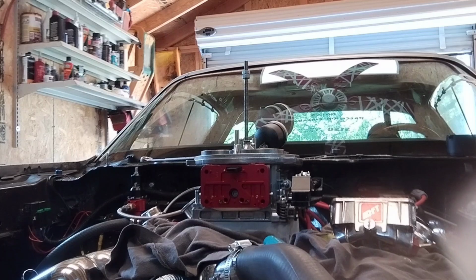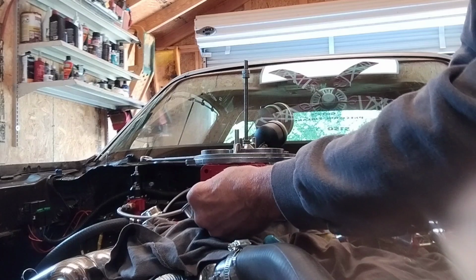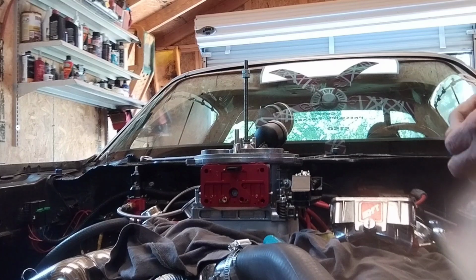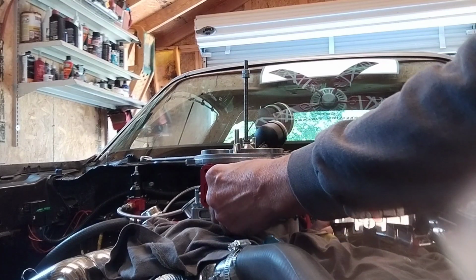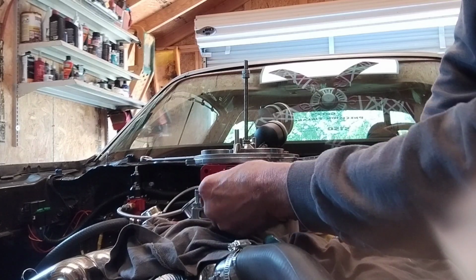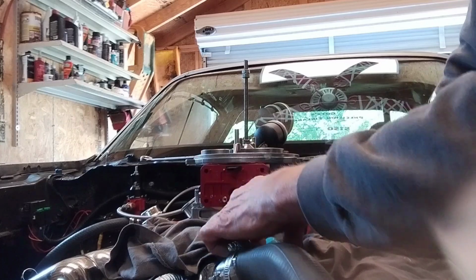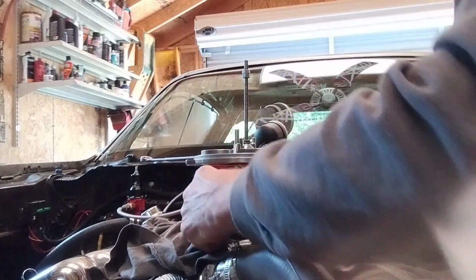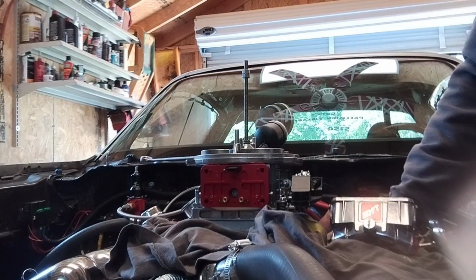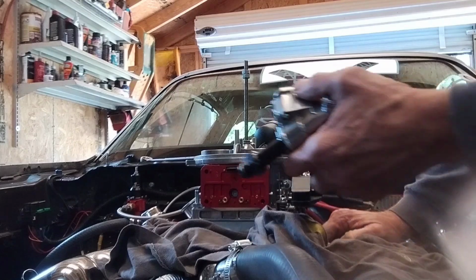Well, I can't get my fingers in there to get the jets out. Hang on, I'm coming back. Okay. So, we got the 94s. And it's not a complicated deal. You just stick them back in and get them started. Don't want to cross thread them. You can mess your whole day up. And then just snug them a little bit. And that's about it.